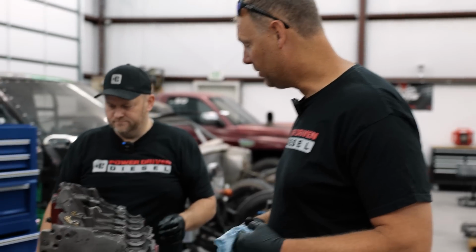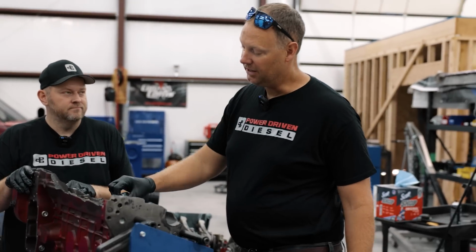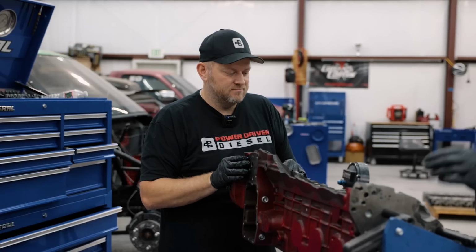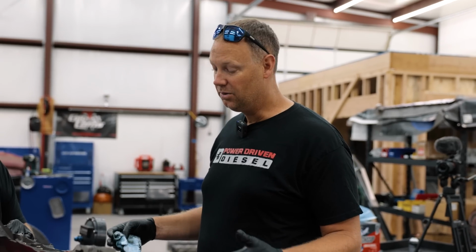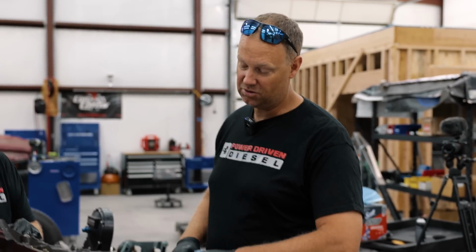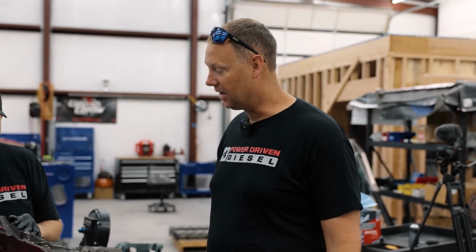Yeah, like when I broke my block for the first time on the drag strip, it broke on the cam tunnel. I think when Sean Baca broke his years ago, it broke the cam tunnel. So this block is the Hamilton solid block, and this is a totally factory block with just solid iron around the cylinder bores. So everything north of the cylinder bores is as strong as you can get, solid iron. But nothing was stronger down here. It was factory, and so it just popped like a stock factory one would.